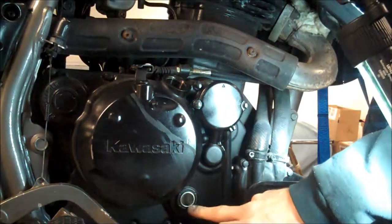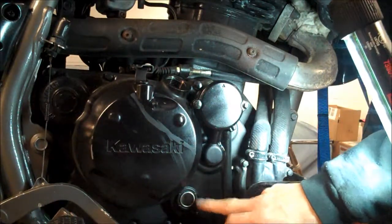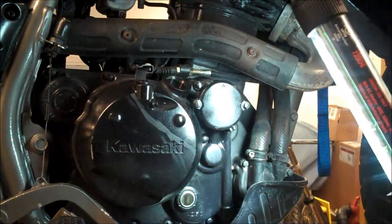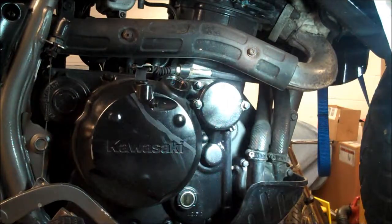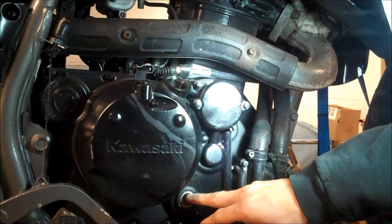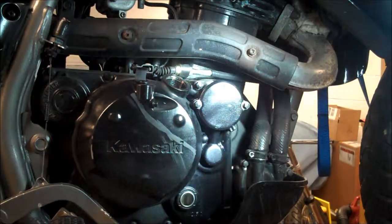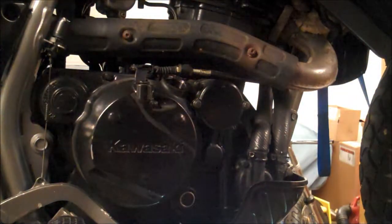Okay, down here is a sight glass. There's two tick marks. Here's the lower level and the upper level. And right here it says 2.5 liters. And that's how much it takes to fill this up. So that's about 2.5 quarts. I'm going to dump 2.5 in, or just to about the full mark. We'll start it up, let oil circulate through the filter, wait a few minutes for it to drain back, and just check the level as well.